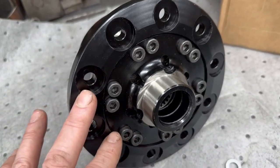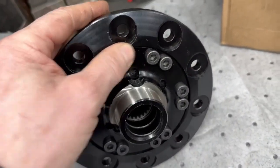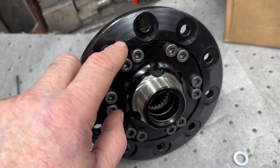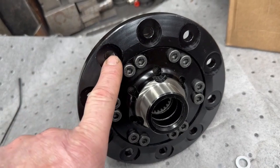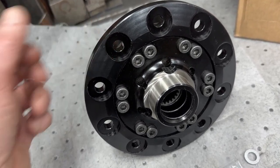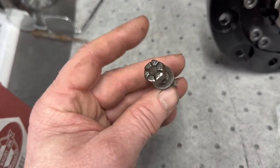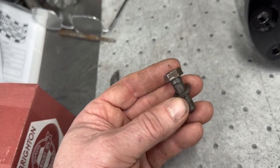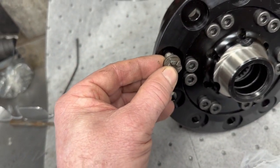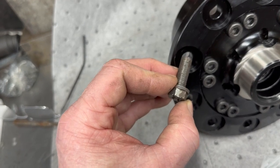Back to the ATB — forget this is the special one, this applies to any ATB. This whole unit is billet and the metal is incredibly hard. We tried to tab-lock convert it and it just blew the cutters apart, so that's a no-no. We've been looking over a period of years at how to keep the crown wheel bolts tight onto the crown wheel. It is a problem with ATBs that whatever you do, the crown wheel bolts will come loose. We've seen ATBs come in with a standard Land Rover bolt — not even grade 8.8, really old school — with a hardened washer. When it undoes and hangs out, it works like a lathe tool on the inside of the casing and destroys it. Or it will break off, and getting a broken bolt out of a crown wheel thread — times ten holes — is an absolute nightmare.